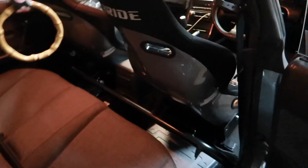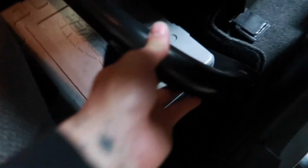But before I close out the vlog, currently planning the next video, making sure I can get the harness bar installed since it is a universal application. So this part on the seatbelt cover pops up, which will expose the bolts, and then we got the bolt below to the seat belt. I did my best one-handing, making sure that everything lines up, and so far everything looks good. And this bar is fully adjustable too, so we'll have to adjust, of course, accordingly.